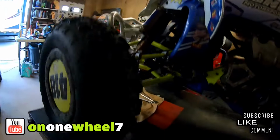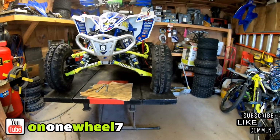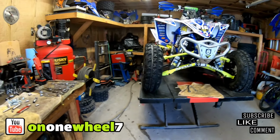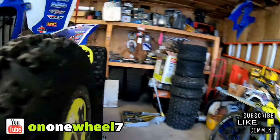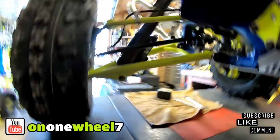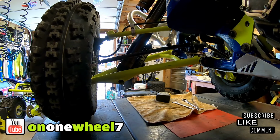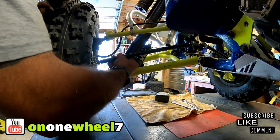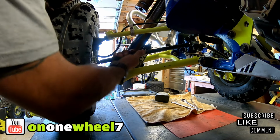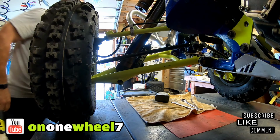So I think I'll just start by eye because obviously these are way in. I can see it, both of them are way in. We'll double check with the tape measure too. So we'll start with this side. Try to go equal turns on each side so it's even. And we'll go from there. So I'm gonna do, gotta go in, that's out. So I'm gonna go in one thread. Do the same thing on the other side.